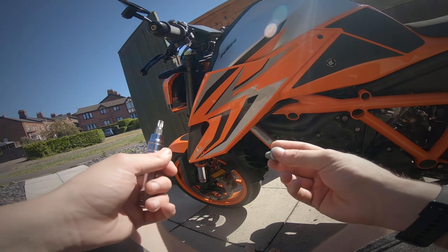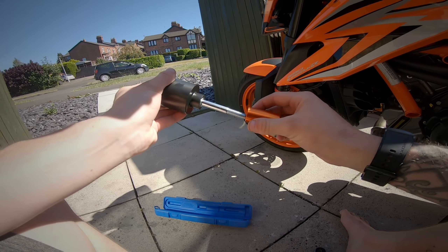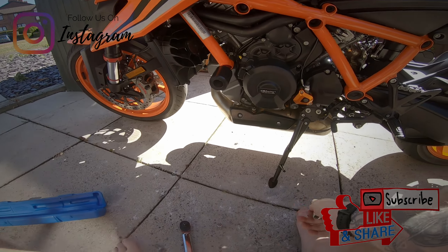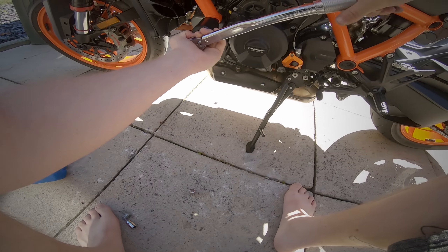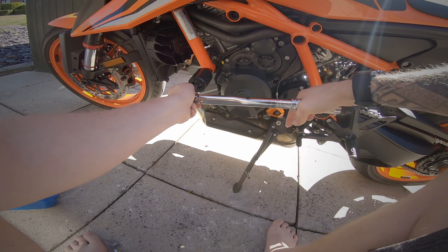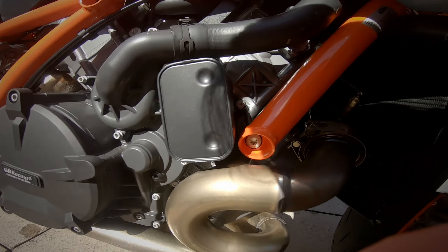Right, then we've got this guy. I'm going to get the bolt, a washer and a lock washer, straight down into there, collar over it, and then start to do this up. I'll swap that one over for the torque wrench. Right, let's get in there. That's 40 Newton metres — done! Cool, right, other side. A bit better there — it's a T-45.